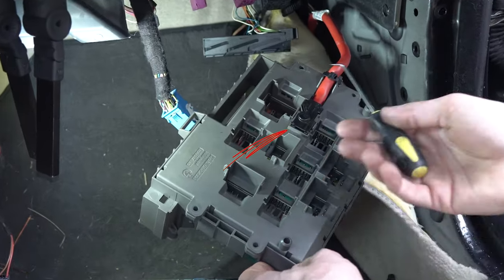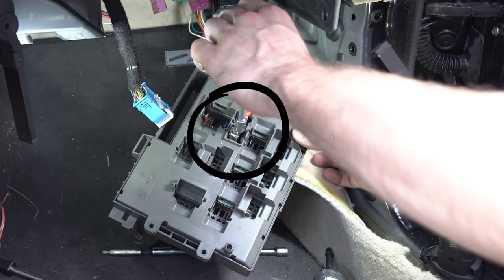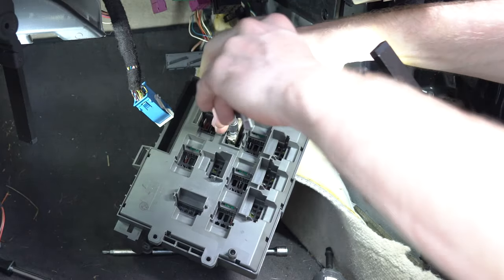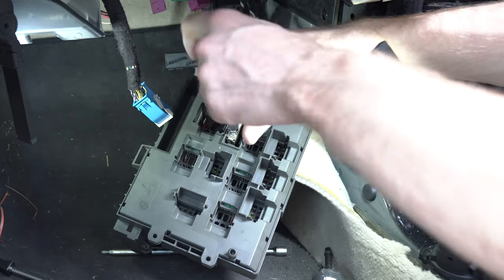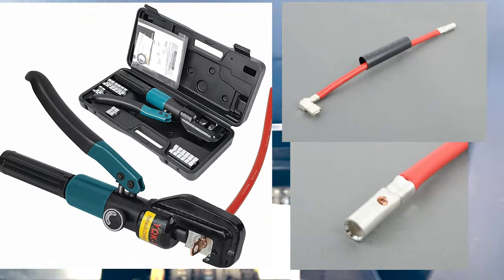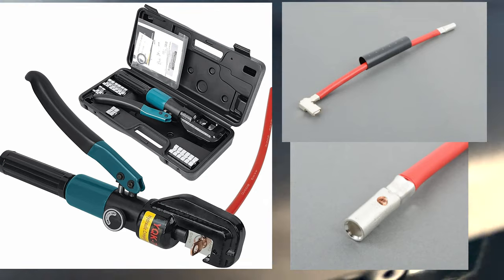The last step is the black cover covering the B plus cable. If there's no sign of burnt connection or melted plastic, you're all good. If it's completely black you'll need to replace it — usually you have to buy the whole unit since it's almost impossible to safely remove the wire, as it will be welded to the connection point. Go to the junkyard or order it online. For the B plus repair kit you'll also need a hydraulic crimper to replace the piece of wire. I'll include the B plus kit in the description. Good luck and hope you won't have any problems with this type of repair.